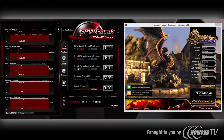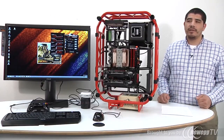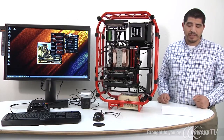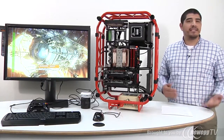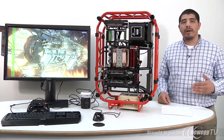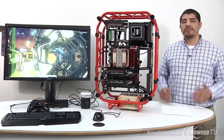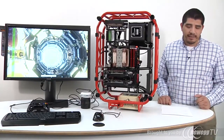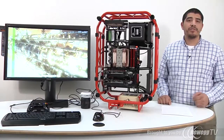With the fan speed at about 2300 to 2400 RPM and fan duty at approximately 69 to 70%, there's still quite a bit of additional room. The card's peak RPM metric is a little over about 3500 RPM, so it can additionally increase cooling performance if needed. Even at 100% utilization, while it would be clearly audible inside a well-sealed chassis, it's actually going to be only a moderate hum in terms of overall pitch. At default, you're looking at near-silent operation. Let's jump into gameplay performance next.